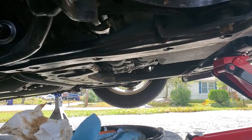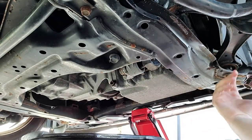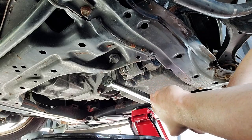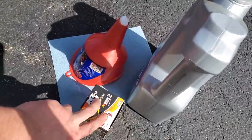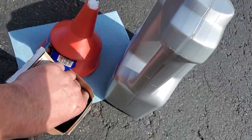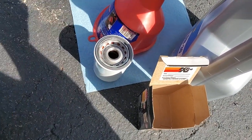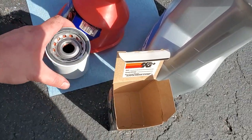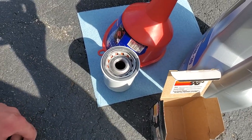With everything off and drained, it's time to put this thing back together. Because I'm going to be reinstalling the drain plug with the torque wrench, and we're going to go to 33 foot pounds. Up next we got a new filter. What I like to do is put a little bit of oil on the inside and then lubricate the ring around the edge. It can be a little tough feeding it up in there without spilling the oil, so I don't fill it too much, but I do like to have a little in there.